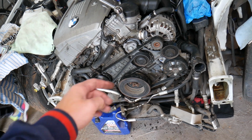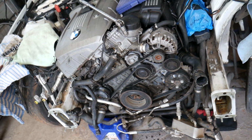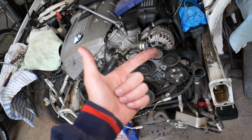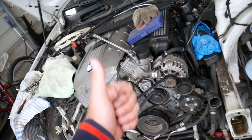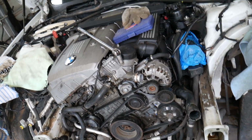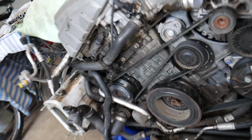You do not need to remove the front end of the car, that's for sure, but you have the radiator fan. You don't want that fan to actually activate and your fingers can get stuck in the fan and it can cut them off. So what I recommend, disconnect the car battery before you start working on the car. Number 2, it really matters on modern vehicles which battery terminal you reconnect and disconnect first, because otherwise you can cause damage to the electrical system, you can cause damage to the engine computers. And if you don't know about that, we have a video that explains all that in the description of the video below. With all that being said, this is the N52 engine.